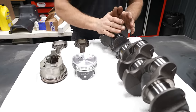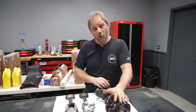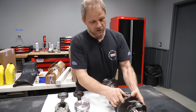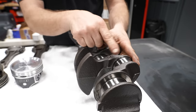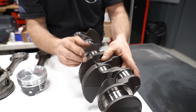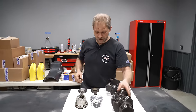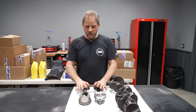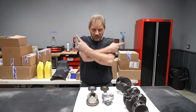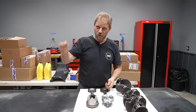At the end of the day, our four liter goes to a 4.6 liter when we put a 4.2 liter crankshaft in it. So that stroke — measured from your crank center to the rod center, times two for the diameter — gives you your stroke. That'll be a little bit larger than our 4.0 liter stroke. And then we get into what do we use for pistons and rods? Well, you do a little bit of mixing — 4.2 liter stuff and 4.0 liter stuff.